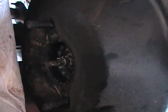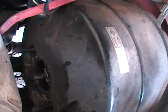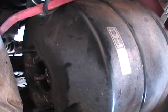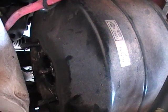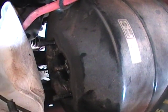Some vehicles are going to have some variance in the way that they work. This being a Nissan, that little plunger just simply presses into the back of the master cylinder and we got nothing to worry about. Some manufacturers have different ways of connecting with clips or bolts. You will have to figure that out as you get it apart. There are going to be little variations in taking them apart. This one was easy.